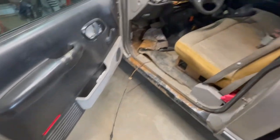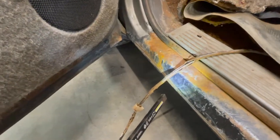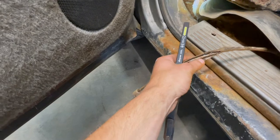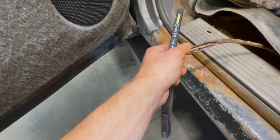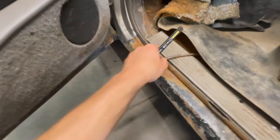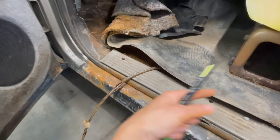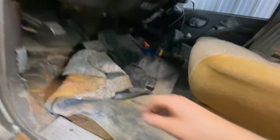Before I go any further, let's really address the problem with this truck. That's obviously the cable and you can see the outside insulation collapsed. So when you went to pull the handle, the cable pretty much collapsed on itself and wasn't actually pushing the transmission into gear. This is the part from underneath the steering column - we remove that. This cable runs under the seat and then there's a little grommet that pops into the floor, which I already popped out from underneath.